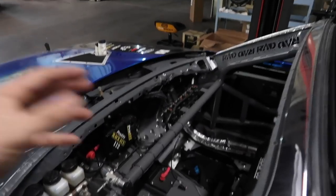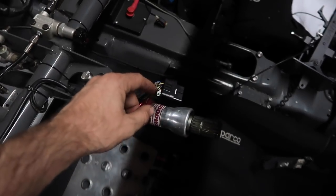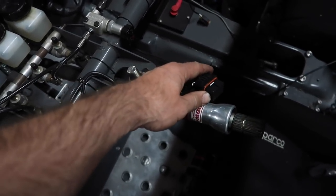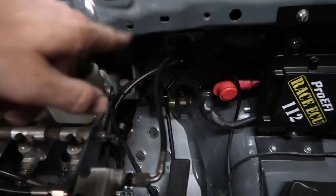Dash is out. We got all our wires exposed. I'm going to have to pin like two wires in — T into two wires — one input so I can do a 2,000-plus PSI sensor for the nitrous setup. I'm going to do that down through the bulkhead on the firewall. We'll show you guys when we get there — that's after we plumb it.